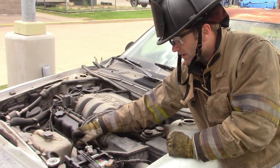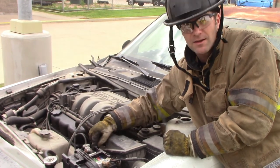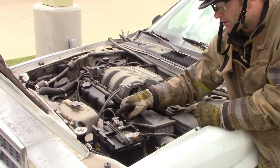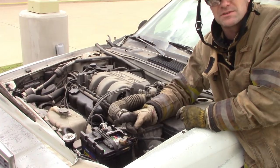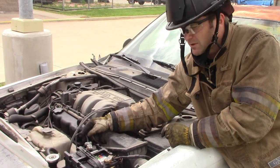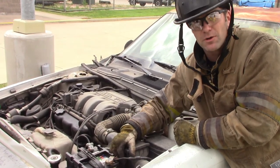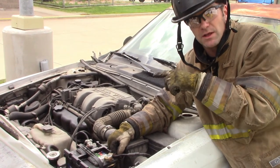We want to cut or take off the negative side first. The negative side is a black wire and also has a minus sign on the battery. The reason we want to do the negative side first is for two reasons. First, the way the power system works, the power goes from the battery down the negative side to the electric components, and then back on the positive side. So if we cut the negative battery cable first, that's going to remove power to all those components quicker. Also, cutting the negative first is going to reduce the amount of sparks that happen when we go ahead and cut the positive, or red, side. The positive side has the plus sign.